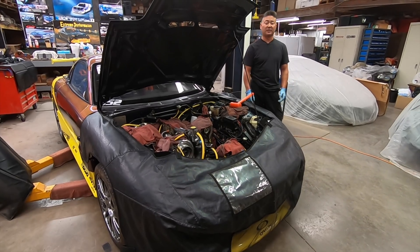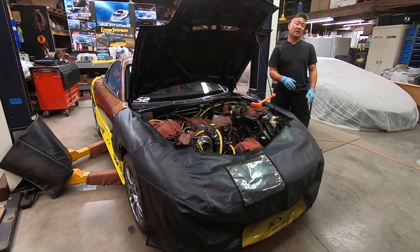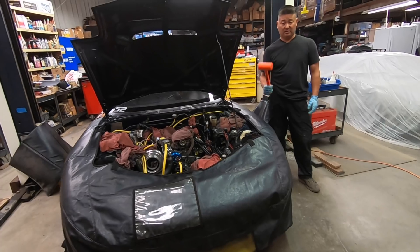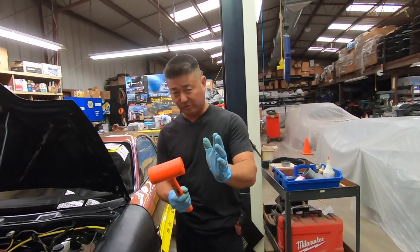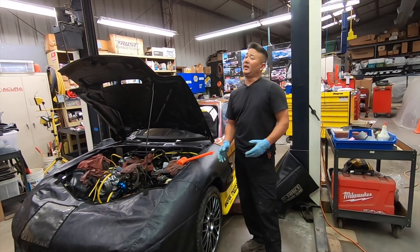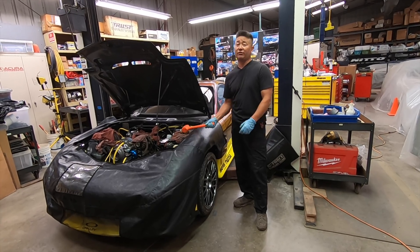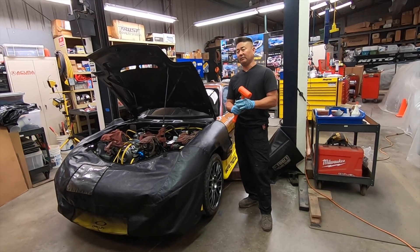The other issue was the starter didn't work — a very common problem with aged equipment. For those of you that don't know this trick, especially for a car that's been sitting a long time, the brushes tend to hang up and the drive doesn't get contact. Our trusty friend the dead blow hammer — give it a few hits on the body. Just make sure you don't hit the solenoid area or where the drive motor is, and you may get lucky and it frees up. That worked on this, and it works all the time on farm equipment. Be warned though: on your everyday car, if the brushes are getting close to worn out, you have a very small window of time before you'd want to replace the starter.